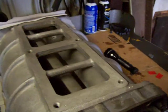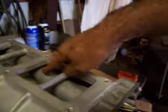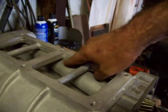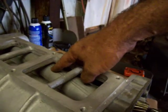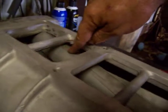We had to kind of go around when we did the one on the Ford Galaxy. On the Galaxy we changed the rear bearing plate. We used a DPI rear bearing plate, and the clearance in here is so tight. I'd have to get my book out to recite everything, but I know on that Galaxy we were getting it down to like 3.5 thousandths through here.